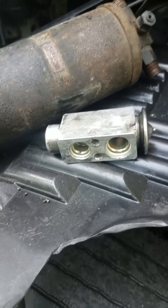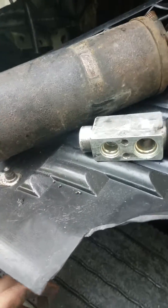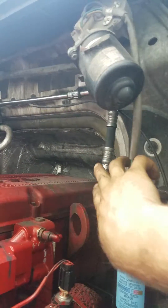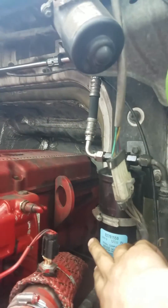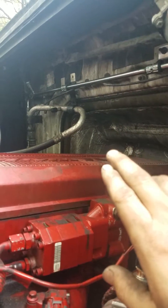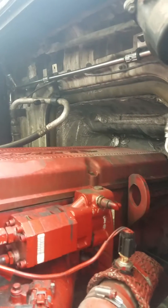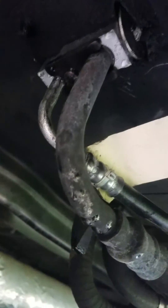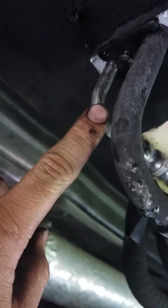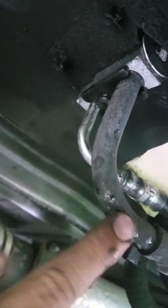So I had to replace my high-pressure AC lines — you can see these are brand new here — along with a new dryer. Did the vacuum check, no leaks, everything works. It was only about a hundred dollars for the kit on eBay. Everything worked perfectly. You can see it runs up into the bunk which ties into the front, and this is where it also got clogged — in the evaporator valve in the front as well. Here's your return back to the compressor.